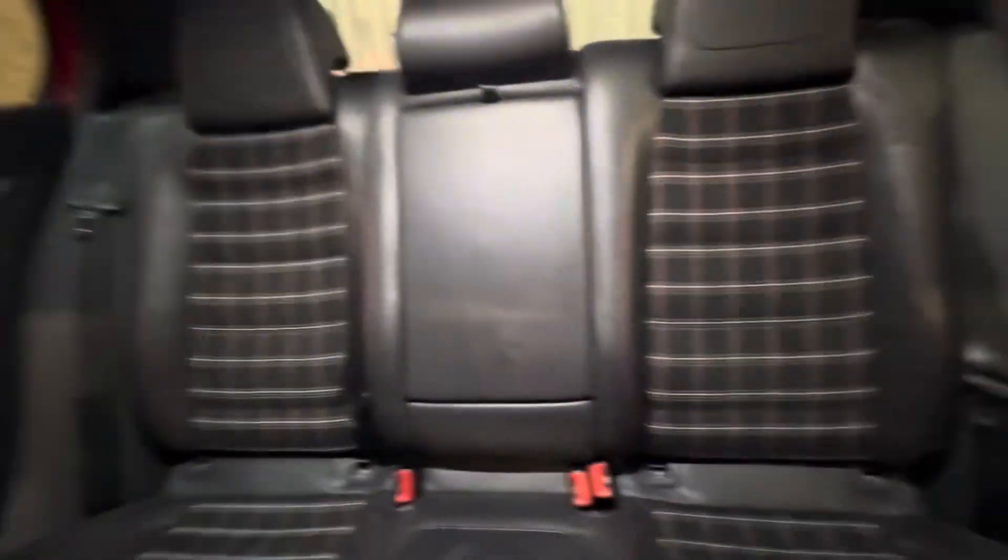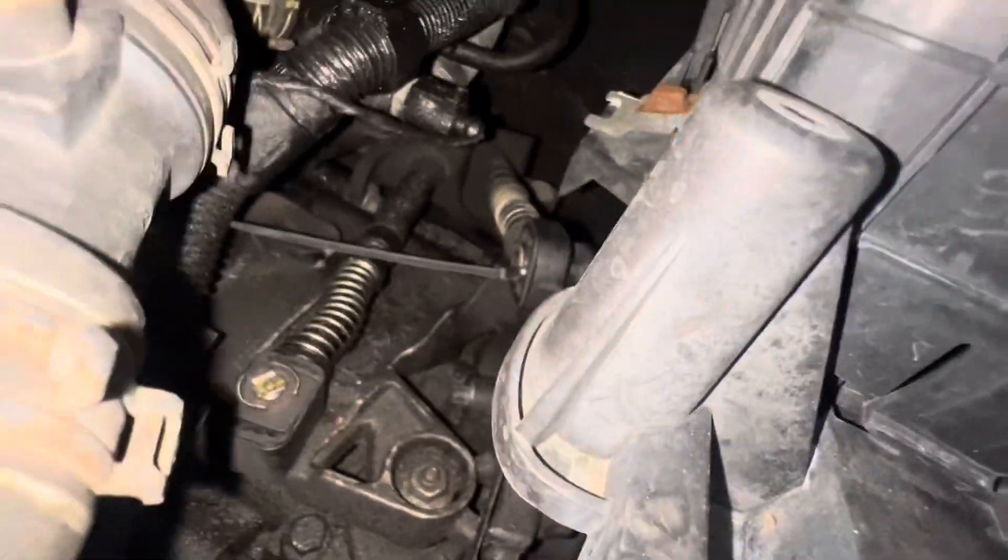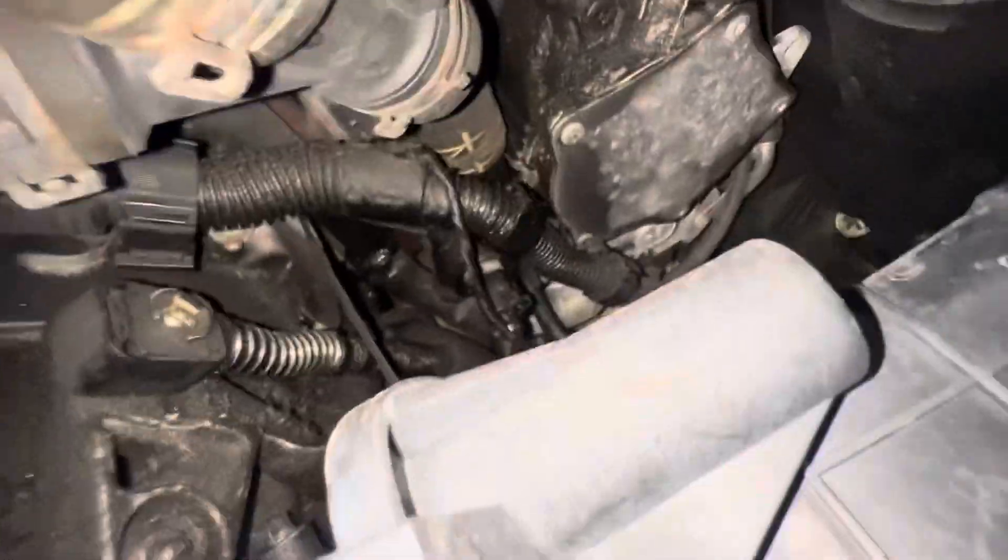Generally, the inside is very nice. The headlining's in good condition, the seats - even the bolster wear isn't too bad. The back seats barely look like they've been sat in. The cup holder's all broken - standard Mark 5. With the gear linkage, you can see there are cable ties holding that down, so we're going to have to look at that. There's also fluid here which I think is coming from the vacuum pump - I do believe there are repair kits for that. So we're going to get a new linkage and a new repair kit.